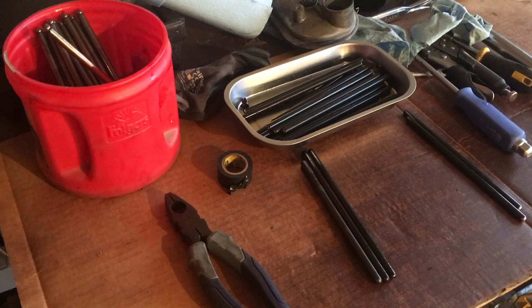This is my video on checking my push rod length. When I get to the other side of the engine, I will specifically check the length of that oddball push rod because I guarantee it's going to be at least a 7.425. With all the others coming out where a 7.400 gives me 75 thousandths preload — that sounds good to me, slightly more than what Comp says but not nearly as dramatic as BTR. So I'm going to throw the 7.400s in there and buy a longer push rod for that one oddball. At least I can verify that lifter preload will be 75 thousandths on all of them when I'm done.